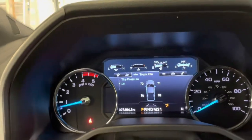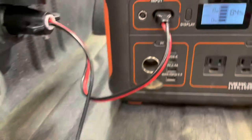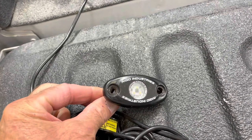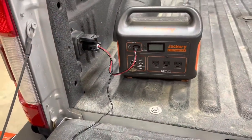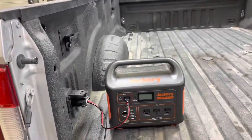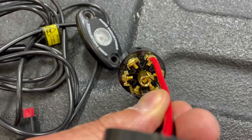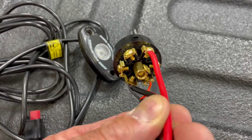So the light is tricking it, but when we go back here there's nothing happening — no power output. You will see this light flash every once in a while; I think that's just the truck's way of determining that it does sense a trailer. So it needs more than just the brake controller output to send power, which is kind of weird. The charging output is at the 1 o'clock position if you're looking at the backside of this plug, ground is at 7 o'clock, and the brake controller output is at 5 o'clock.